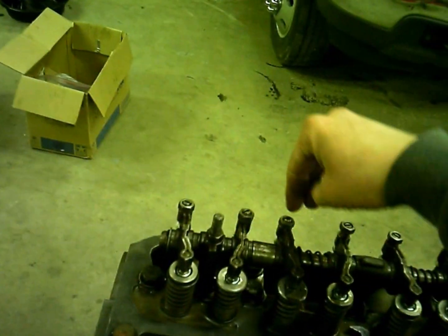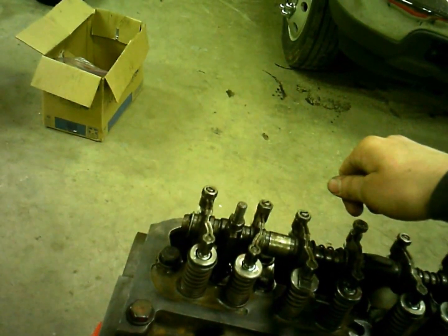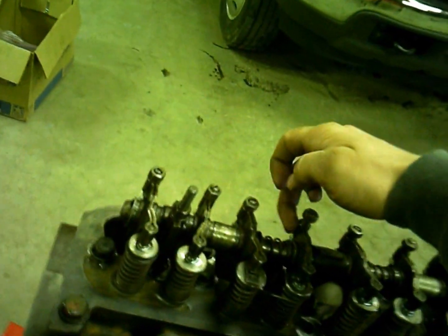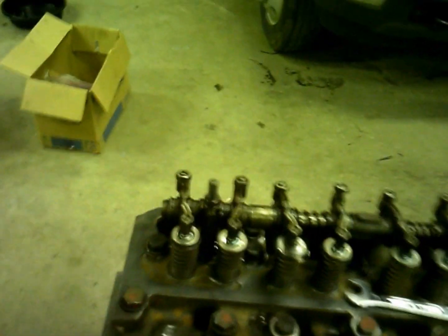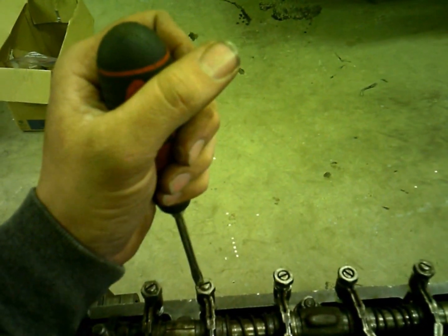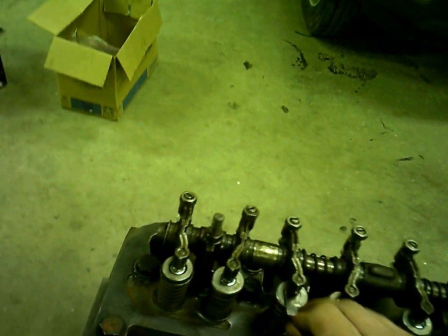and those things didn't have a jam nut, they just had this threaded screw that ran down through, and it had a hex head on it, and you'd tighten it up, and they had this crushed where it was like a lock nut, and it turned hard, but you never had to set a jam nut. So once you found your right drag on it, you just let go of it, and away it went. You never had to try tighten up the jam nut and hope it doesn't move or anything. But this one's going pretty smooth here, so that's about how you set the valves.